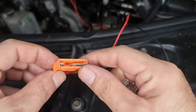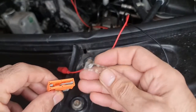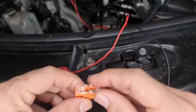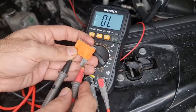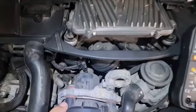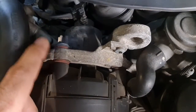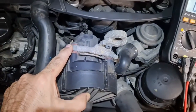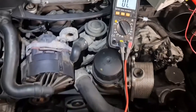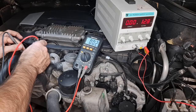These fuses have an inspection window. If you remove the glass cover it is much more visible. Our fuse is good. As for the pump itself, the resistance reading for the secondary air pump is 0.2 ohms — which is almost zero.